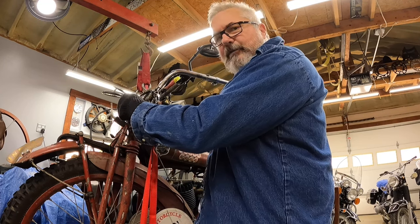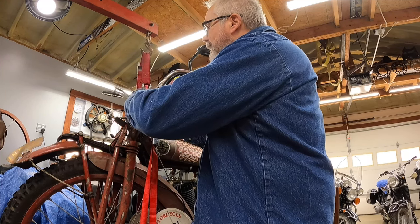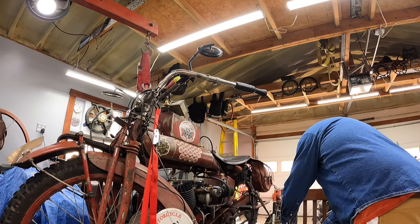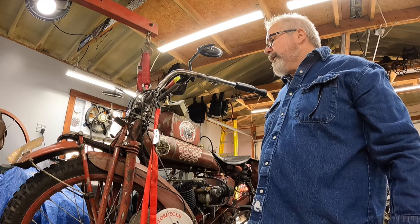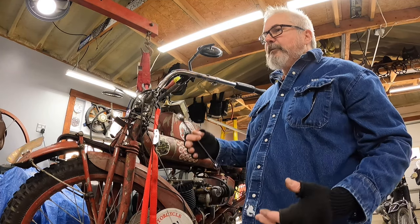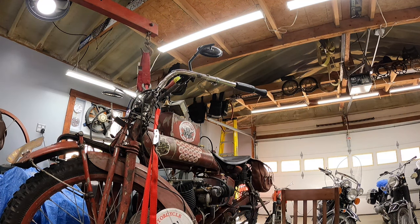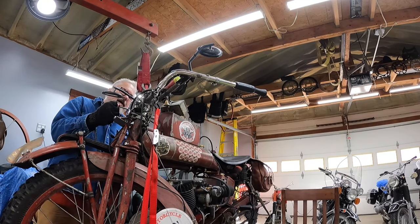It's not difficult to do, but it involves a little math because you have to calculate the surface area of what you're plating, which in this case isn't too bad, to come up with a decent estimate. However, some things are more complicated to calculate the surface area of. Then you have to calculate how fast the solution is going to give up its nickel, and from that figure out when you have to add more chemicals to the solution. So there is a little bit of math involved with nickel plating, but I managed to figure it out. Caswell has a pretty good plating manual that they include with the kit.